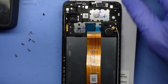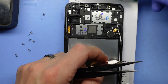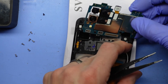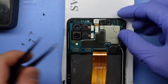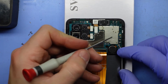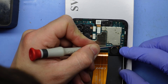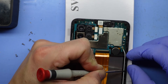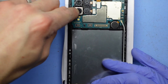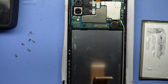Next up I'll put the main board back in. Take off this cover, line it up, and also remove the front facing sensor or the front camera. I should just be able to fold these up and drop it in. There we go — that's in place, just tracing over that to push it back into its location. Next up, make sure those cameras are sitting right, then I need some tape to re-tape the battery back down.